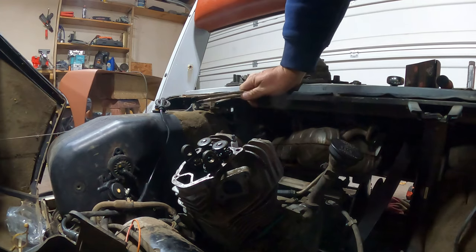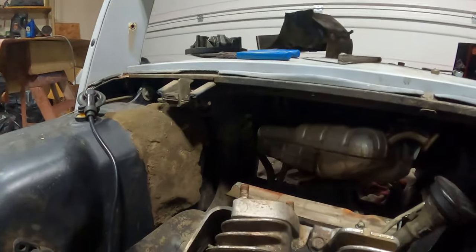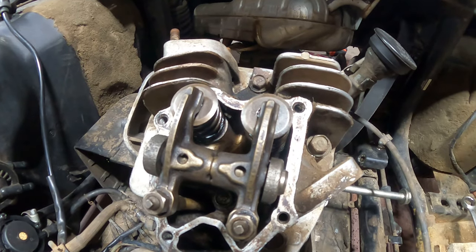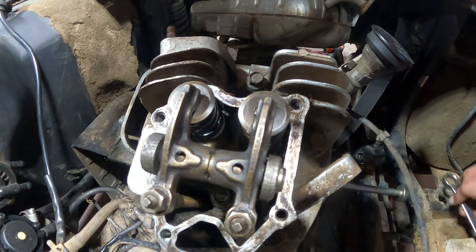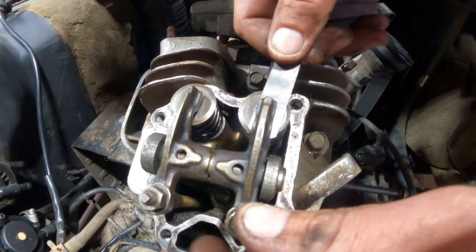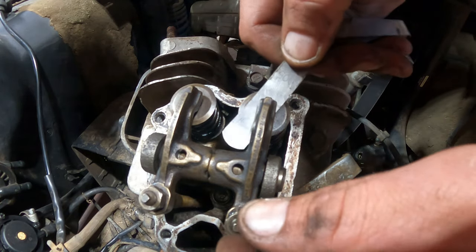Well, I'm gonna have to figure this out, and then we'll bring you back in here. All right, crisis averted. We got lucky. We didn't get lucky. I was pretty sure I had the poppets or whatever you call it, the lifters, in there. So I just had to get the rods in there right. So that one's going down. This one's to be fully up. Let's go ahead and reset this. And that's a 5.2. I should put that at a 4, but we're going to do it at a 5.